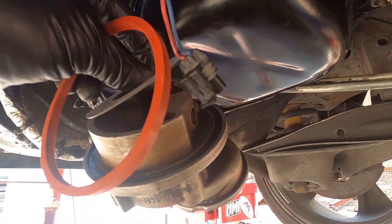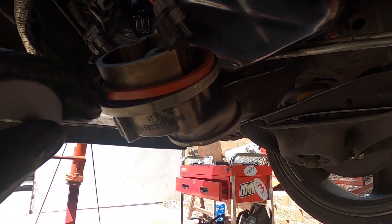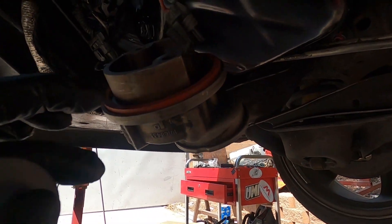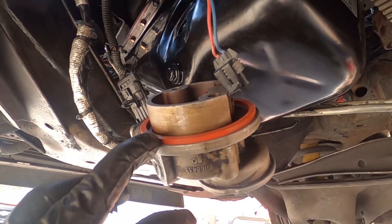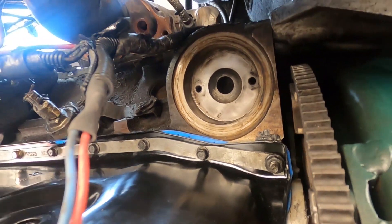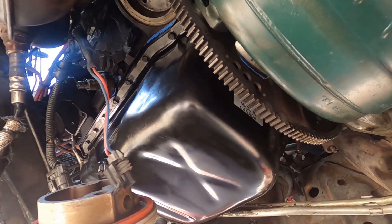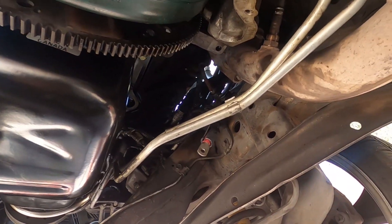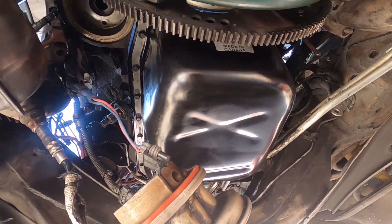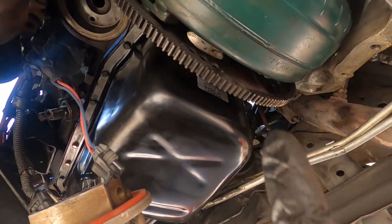The rubber seal goes around the oil filter adapter housing — I can get it on with one hand like so. These bolts on the oil cooler adapter are like Allen set bolts — those are also 15 foot-pounds of torque. Torque those down to 15 foot-pounds and make sure that surface is nice and clean. Once again, we had to take out the starter, remove the exhaust flanges, motor mount bolts, and the flywheel cover.